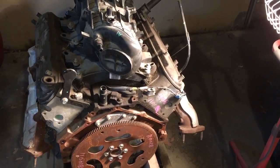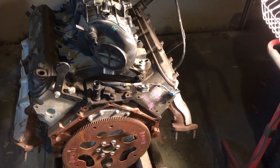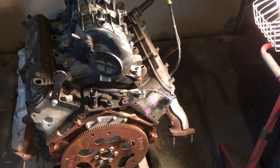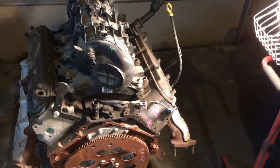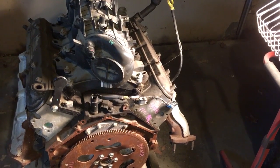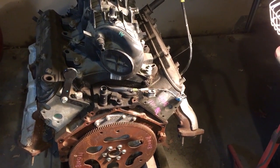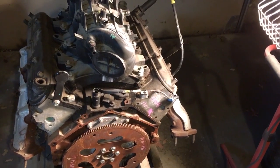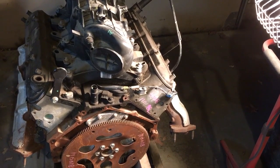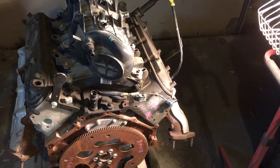What I need to find out is what year of 4.8 I bought. Because the cam sensor is in the back, it's most likely going to be a gen 3 engine — that's another indicator, though not always 100% accurate on the switchover years. As a general rule, if your cam sensor is in the back of the block it's a gen 3; if it's been moved to the driver's side of the timing cover, it's a gen 4.